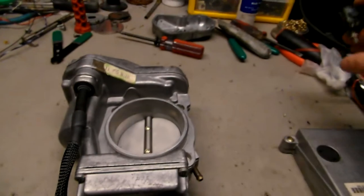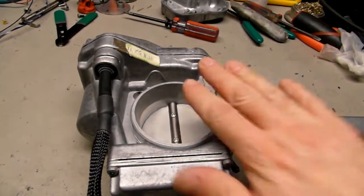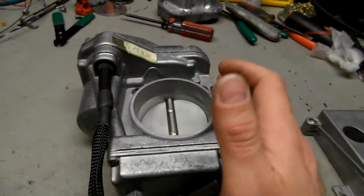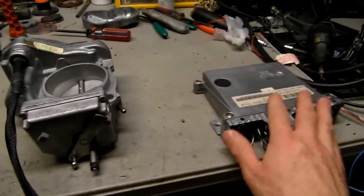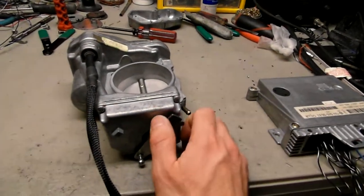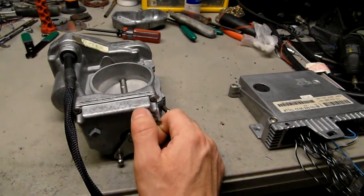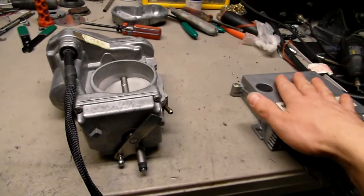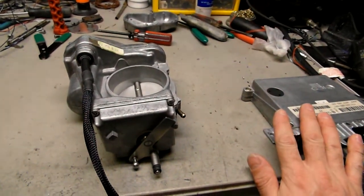So I'm going to power it back on. As you see, the throttle plate twitches to get throttle plate and throttle body to idle speed. To get it ready, and there it goes. Basically, both of these units, at least on idle, they work pretty fine. I don't see the reason why they wouldn't work when they work off idle, you know, when it gets warm.